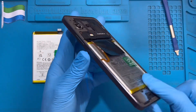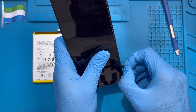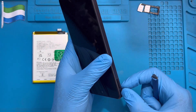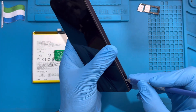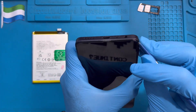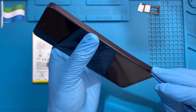After you remove all the screws, take out the SIM tray and put it to one side. Now if you have a pry tool or a pick, you can use it to open the back cover. If you only have a pry tool, use it to slowly open the sides of the cover. Be careful of the fingerprint cable when you open it.